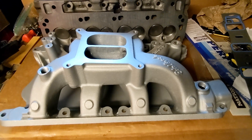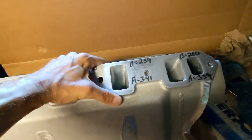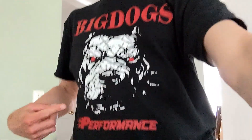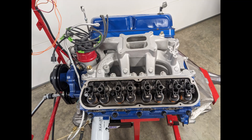This is the other intake manifold that I tested. It's an Edelbrock Performer RPM air gap that has been ported by Big Dog's Porting, so the cross sectional area on the runners of the Edelbrock are larger than the non-ported TrickFlow R-Series. I would expect the TrickFlow R to give more top end power, based on the dual plane's combination of short and long runners being tuned to a lower RPM versus the shorter straighter runners on the TrickFlow R being tuned to a higher RPM. It will be interesting to see how that works out on the dyno.